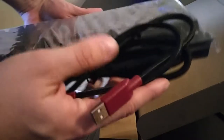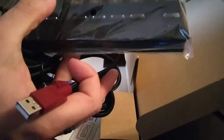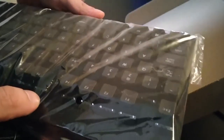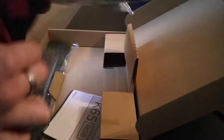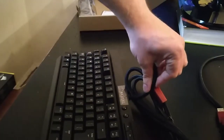So here's the keyboard itself right at the top. Let me explain something that a lot of people get wrong: this keyboard comes with two USB cables. If you plug it into one USB, it has to be USB 3.0. If you only have a 2.0 interface, you'll have to plug both in, because RGB keyboards need more power than a single USB 2.0 port supplies. If you only use one 2.0, it will start to lag and not function as intended.